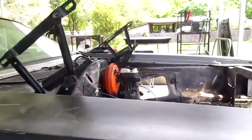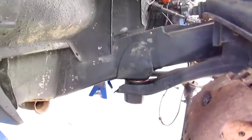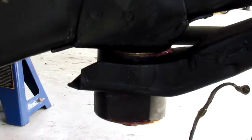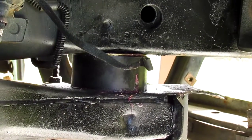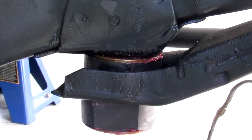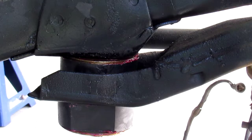To give you an update of what I've been doing: I got new K frame bushings, as you can see here — those are installed. And I did some welding repairs on part of the K frame just to make sure it was solid. Part of it was a little rusty, so I wanted to fix that up. Those are in.